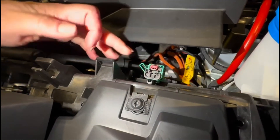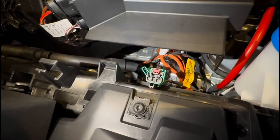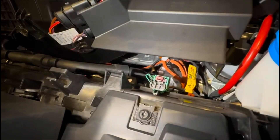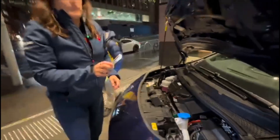Basically what we want to do is pull this black part out of the green part of the plug. It's a little tricky — it's going to be difficult to do with full firefighting gloves or PPE on. But that's essentially what we can do first of all, and this has become quite common in a lot of electric vehicles.